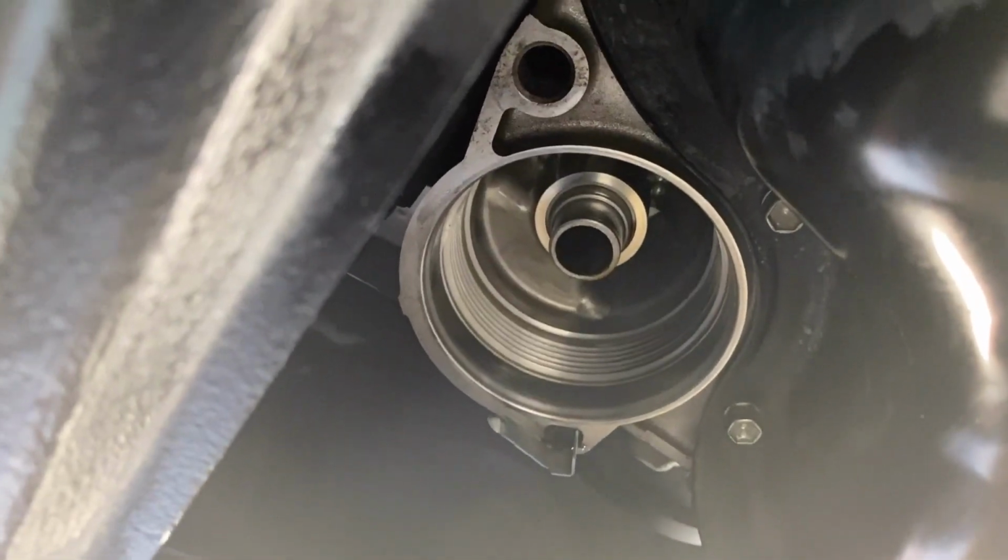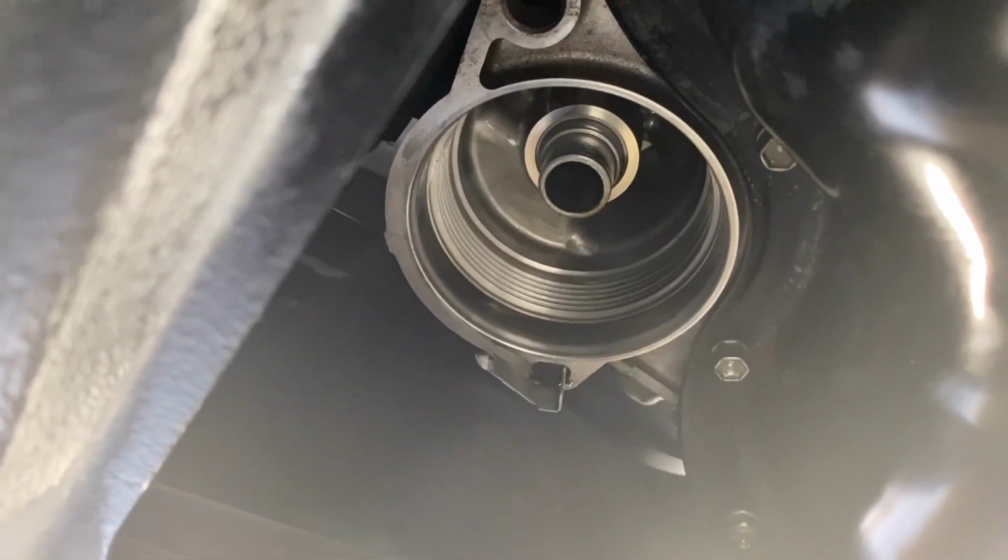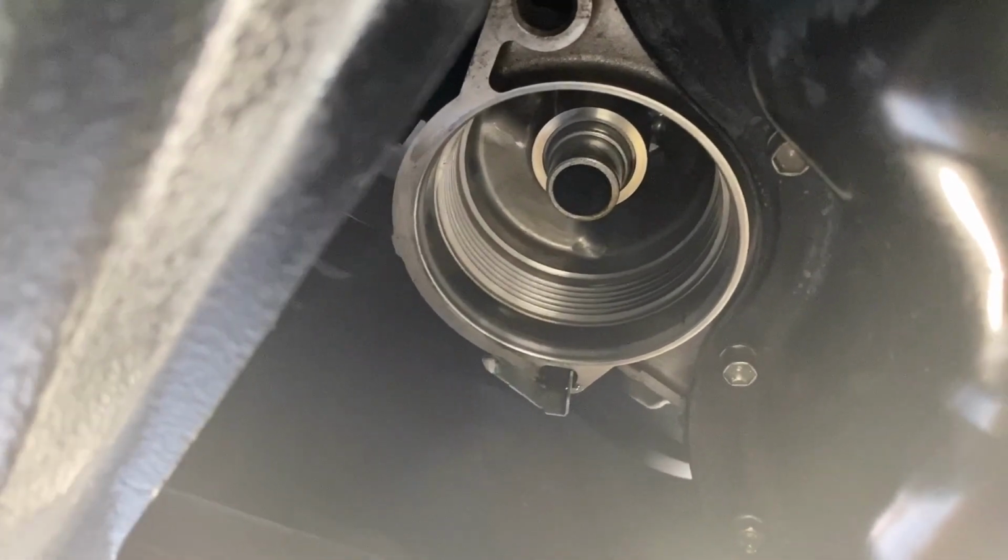Okay, so before you move that pan, all that oil residue, get that towel and wipe it. And that's where the filter goes. It's all up here. Yeah. The actual oil pan too. All right. Is that good enough? Let me see. The reason you want to clean all this area is that whenever you start the car for the first time, you can check if anything is leaking that you touched. Like that before you start driving, you don't want to drive with an oil leak.